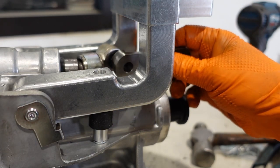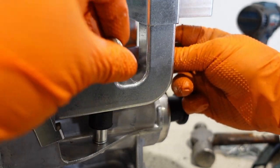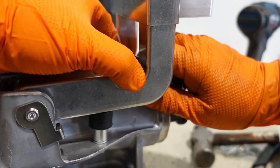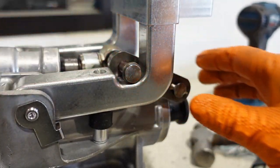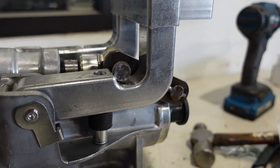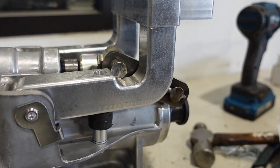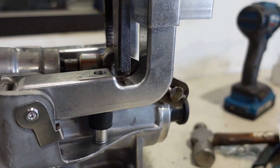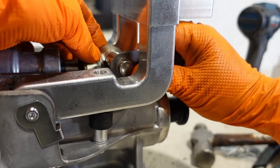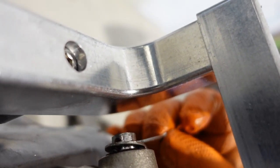There is one end of the link bar with a welded pin and one end with a spacer built onto it. The side with the spacer faces the driver's side of the transmission and has a free-floating pin installed through it. Add a washer to the pin and lube it before installing. Get the pin started partially in the link bar, then use large channel locks to slowly squeeze the pin into place. Since all our parts are new, they're a little stiff — just work slow and steady. Watch out for the pin wanting to poke through the other side of the flex coupler at the last three-eighths of an inch or so.